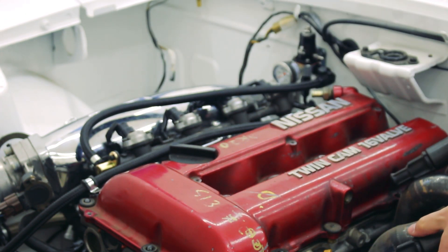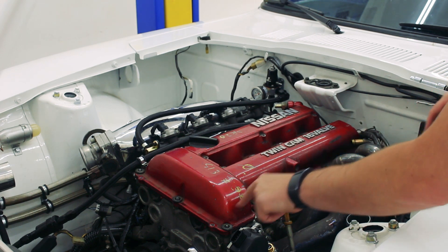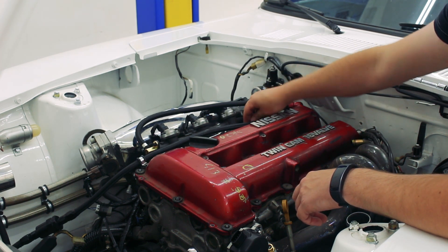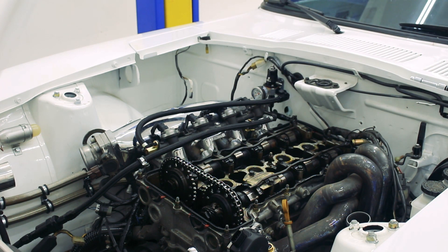In my case, my exhaust is cool, so that is a safe place to lay them. Once you have the coils safely stowed, you will need to locate the nuts holding the valve cover onto the head. These are located around the outside and inside near the coil packs. Once you remove these, you may also need to remove any breather lines or grounding wires that are located near them. Be sure to keep the grounding wires available for when you reinstall. Underneath the valve cover, you will find a gasket. This gasket fits in a channel on the valve cover and may be siliconed to the head in several places. If this is the case, it will not come up with the valve cover and you will want to be careful not to tear or damage the gasket in the process of removing the valve cover.